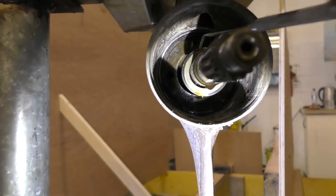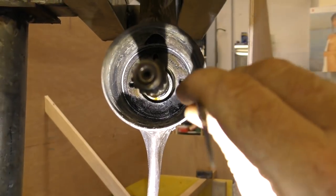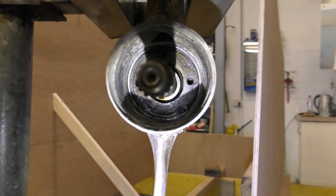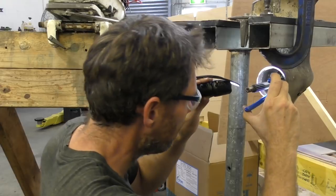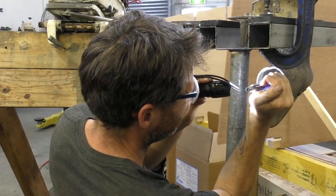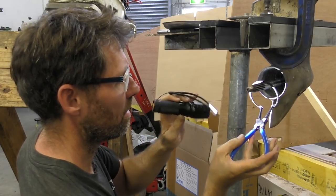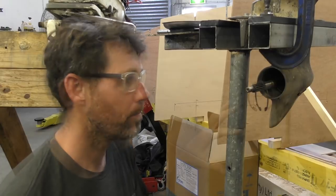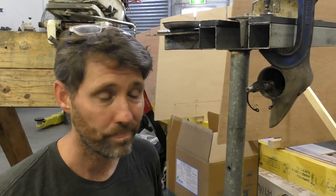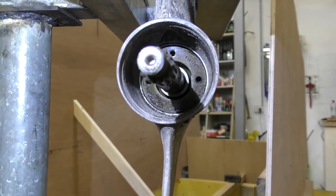In the gearbox here, we've just got a thrust washer we can pull out. The next thing, if we look on this side, you can see the two holes for a snap ring. I need to try and squeeze some pliers in and get that snap ring out. These things are under a lot of tension when they're in so just be careful — put some safety glasses on because if it springs off it could go in your eye. Now the circlip's out, you can see the retainer plate behind it has flopped forward a bit, so it looks like that's going to be pretty easy to pull out.